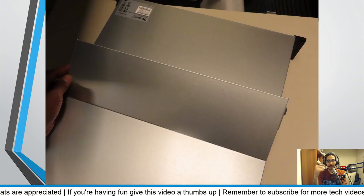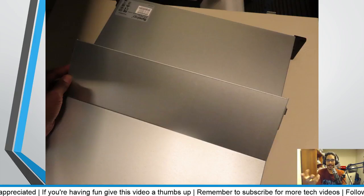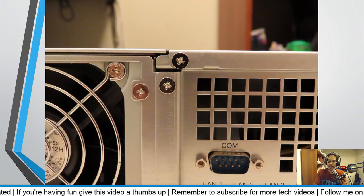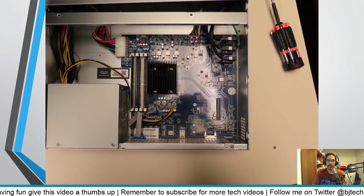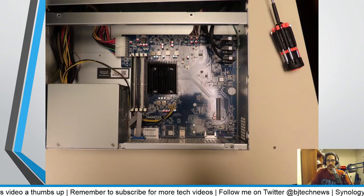All right, so that's the panel, me putting the panel back. Now, to remove the entire panel where the motherboard is located, there's only one screw, and this is the screw right here. It's not these guys right here. It's this guy right here sticking out like a sore thumb. So you unscrew it, you take the panel out. Panel's pretty easy to remove. I think you just slide it towards you, and once you slide it towards you, this is it.